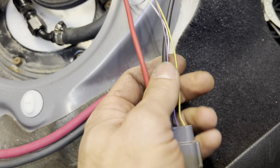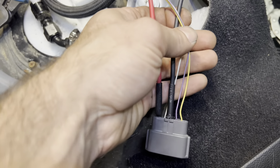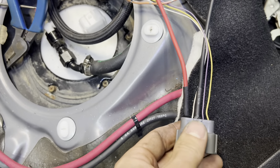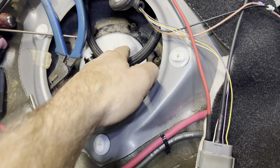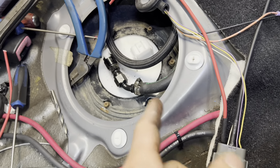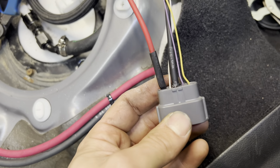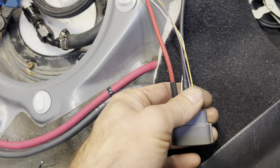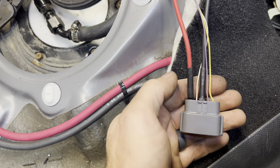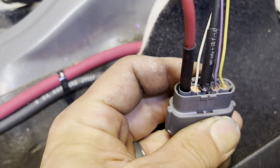Now I need to put some caulking around it. We've got bigger wire coming in — it's a 320 or 340 pump, not a massive pump, but the beefed-up inside wiring should help. I've got factory connections on the pins and I reinforced the inside wiring as well, so I don't expect any heat issues. This pump won't have to work super hard since it plumbs into a surge tank. I'm going to use RTV and seal the whole area, then wrap it with ultra weather tape to ensure no water intrusion. It's a very tight fit.